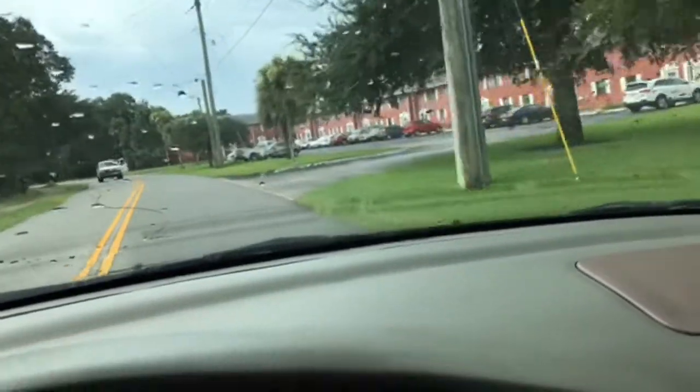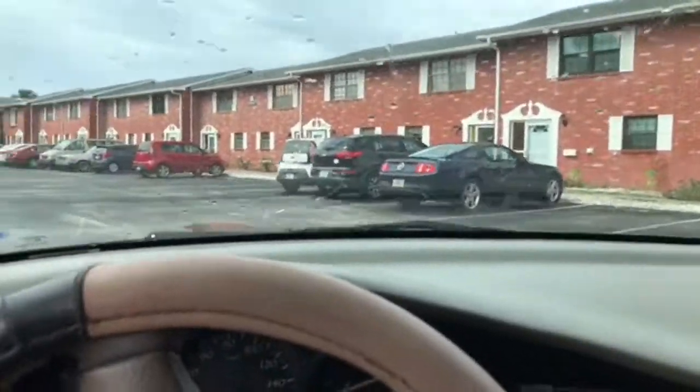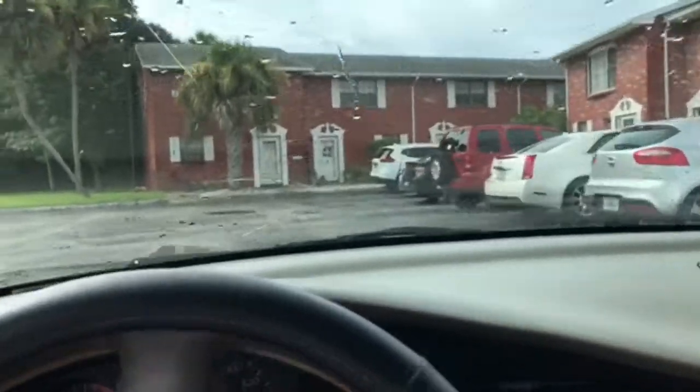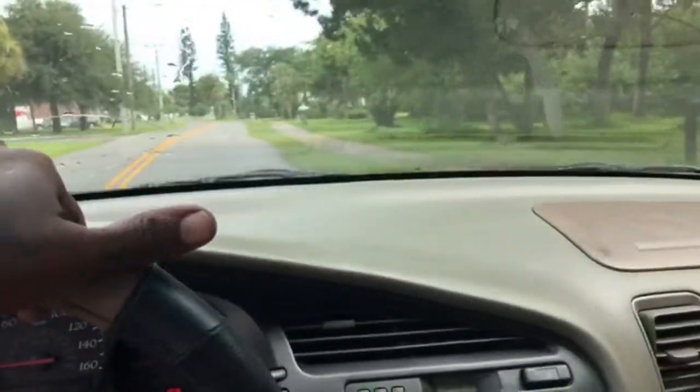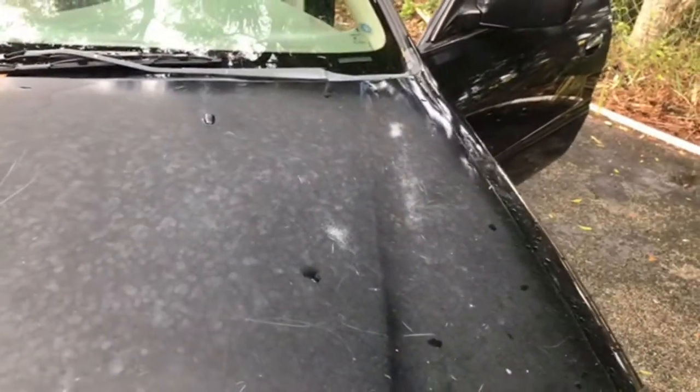Having a transmission issue even after I changed the shift solenoid, but I found out through the Acura dealership that when the transmission fluid is really, really dirty, you want to change the transmission fluid two or three times back to back, because you don't want to flush these transmissions on these vehicles. So you basically drain it, fill it back up, drain it, fill it back up, and it'll do a light flush. Okay, the amount of work I did to it.